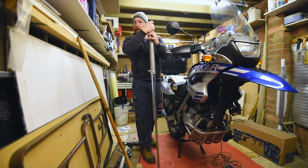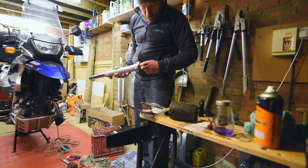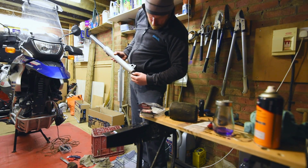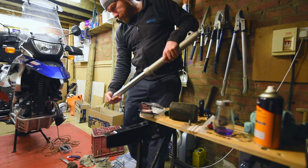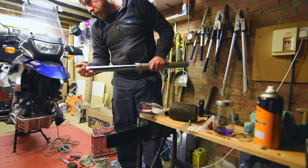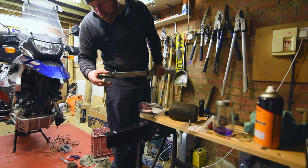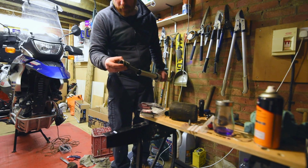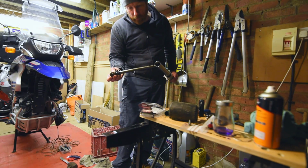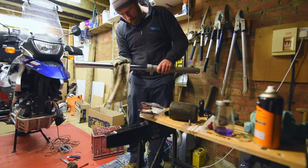That is a hell of a lot of unnecessary effort. So I managed to release this off, so completely remove it, you get a washer, dispose of the washer. Once that's done, you can release the damper rod, which seems to have the bottom there, and then it comes out with a little mini spring of some sort. It's got a name, can't remember what. And slide viciously apart.